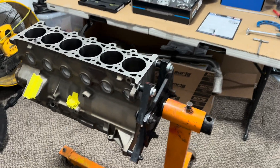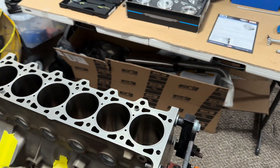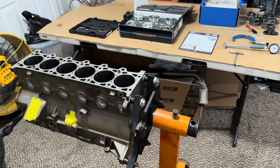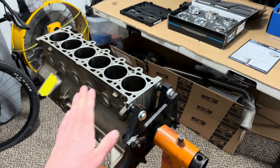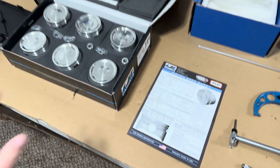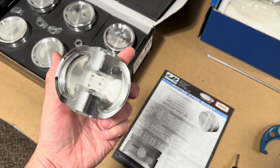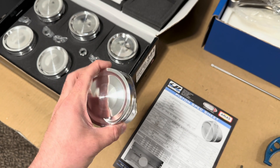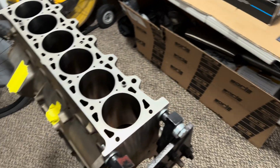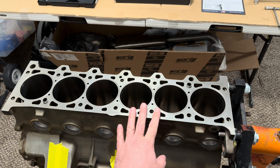Welcome in everyone. We've brought this 3.0L M20 project indoors because it's starting to get wintertime, and to be comfortable we're in a little storage room here that stays pretty warm. I'm going to focus this video on just doing piston to wall clearance. We have the set of CP Carrillo pistons that are custom for a 3.1L M20 — these are 85mm bore — and I want to show and highlight how I measure up the piston to cylinder wall clearance on this engine.